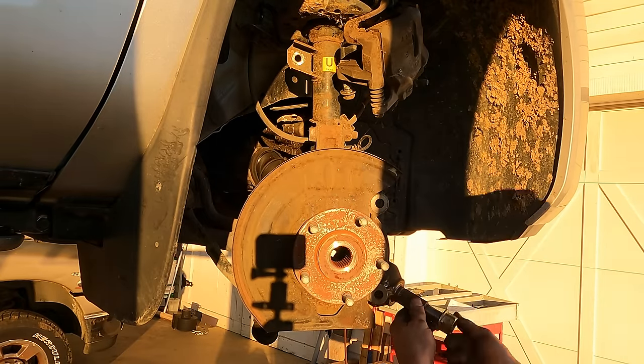Okay, now it is a matter of pulling the transmission bolts. I've already got these loose. We need to lower the car, get the top ones, get jacks underneath both the engine and the transmission, and then we're going to lower and work it out.